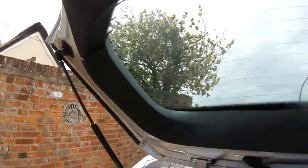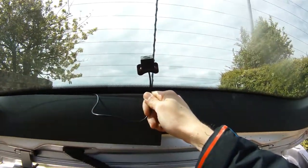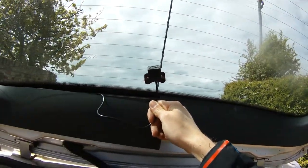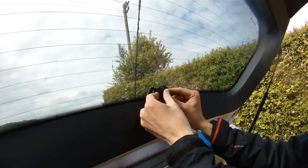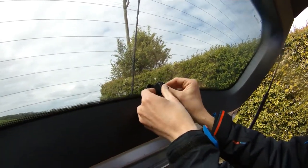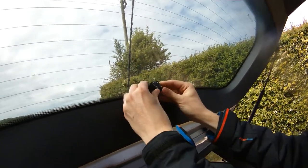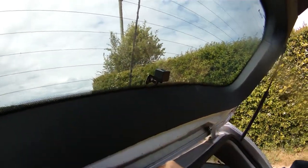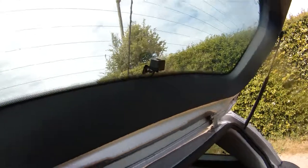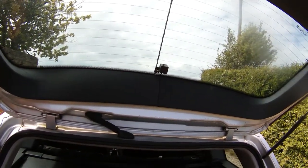I'm now putting this panel back on — the cabling is all tucked away in there — and then we'll stick the camera to the rear windscreen. Use the supplied double-sided sticky pad, get it central, stick it in place, and then adjust the camera as needed. That's how you fit the rear part of the Tugard mirror dash cam system.